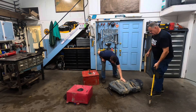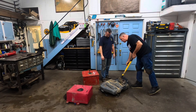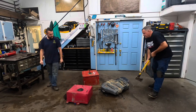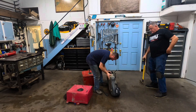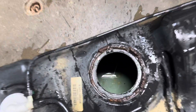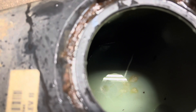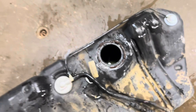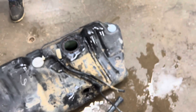It blew a bolt out of the cover — I'm surprised it didn't pierce it though. There's your puncture wound — that's leaking now. Motor vehicle collisions on a real track are way harder than that. Let's try it on the bottom — that's where it's going to get hit most. You can see it turned the white part of the polyethylene inside white but didn't actually puncture it — there's water in there from being outside. It didn't puncture the tank, which is kind of what we expected. That's a direct hit with an axe and no skid plate.